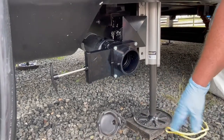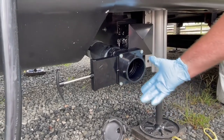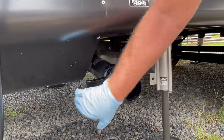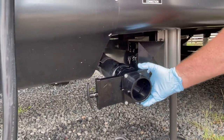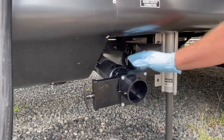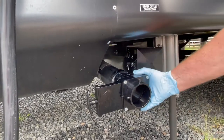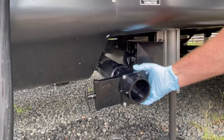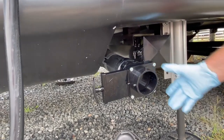No odors and nothing dripped down. Especially if you're on a concrete pad, you wouldn't want even that gray water — some of the soapy gray water is not going to have a pleasant smell. This will help you especially if you've got the kind of wet bay like we've got, where the dump valves are way up in there. You'll have all that settled in there pretty easily. This is a Valterra T58 valve — you saw how simple it was to put on. No more drips, no more problems.